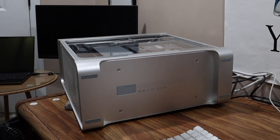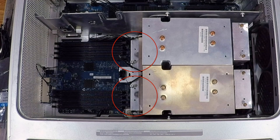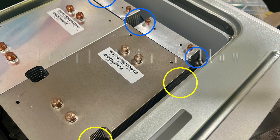To confirm this, I laid the computer on its side and retried the power-up, and this time it booted up correctly — telling me I just needed a better way to secure the processors. I went with eight zip ties and four screws: four zip ties and two screws per processor, two zip ties on the front side and two on the back. For a little overkill, I also added two foam pads under the second processor for additional support. This setup secured the processors to the logic board to my satisfaction.